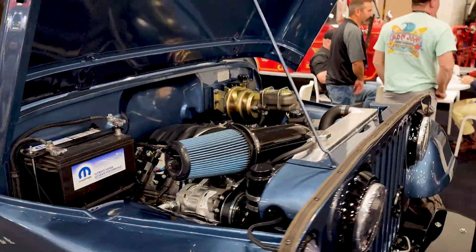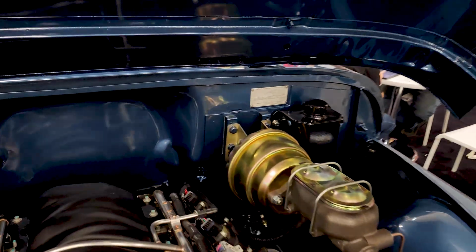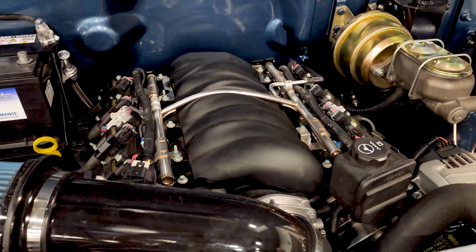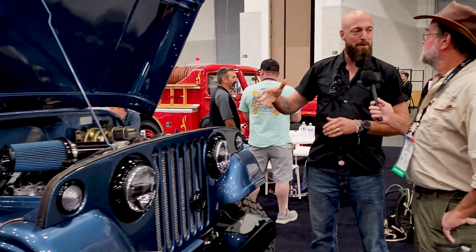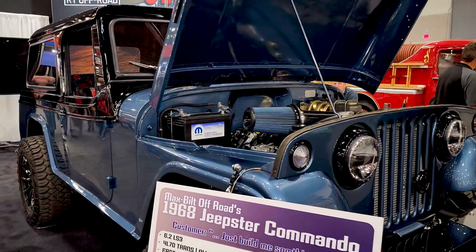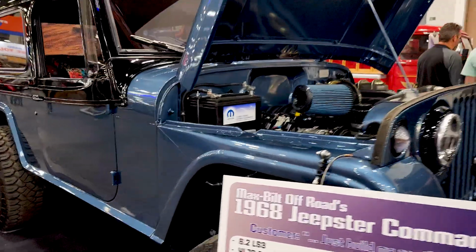We ordered that right from Chevrolet as a crate motor, with the wiring harness and the automatic transmission. Then we chose to run an all-wheel drive transfer case out of a Denali, so that we could make sure it was a comfortable driver that just put the power to the ground. This motor in a two-wheel drive, you'd be spending more time spinning tires than cruising the streets. Well, if you've got a hot shoe.